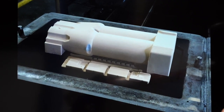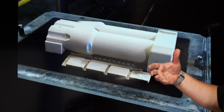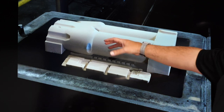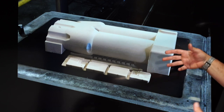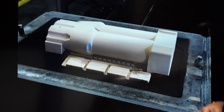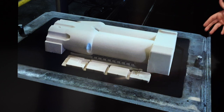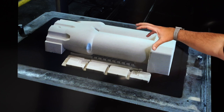Mark shares foundry photos. Whether it's intake manifolds, cylinder heads, or superchargers, they're all done as sand castings. A sand mold is created — this one shows the internals of the supercharger. It uses very fine sand; different fixtures come together and the sand is pressurized at around 8,000 PSI to solidify it. The fixture is placed inside a second type of sand mold with a top piece, then aluminum is pumped into the mold, filling from the bottom up to encase the sand.